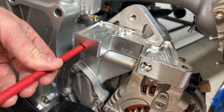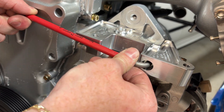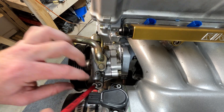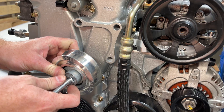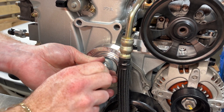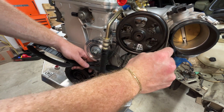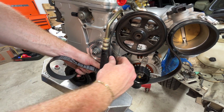It took me a bit to figure out the hardware because there are no instructions. You actually have to mount one of the bolts before you mount the bracket up at all. I also realized you don't put the washers there because they're meant for the idler pulley. Now I'm routing the belt through all the pulleys — it's a little tricky because it's brand new and needs to stretch a bit. I put it around the crank pulley and then used a ratchet to spin it on.